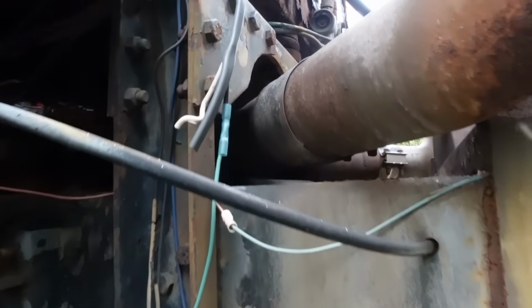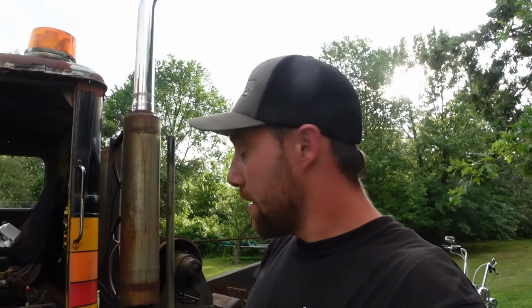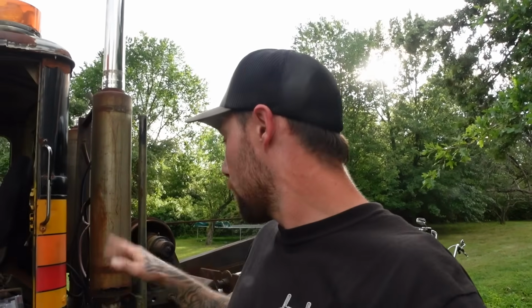It's got dual exhaust, obviously, being a V8 engine. So first order of business is to go in there and get those underneath sections. It goes from flex off of the manifolds, maybe 3 foot or whatever it is, and then it turns to that hard 4-inch pipe, and comes out to these elbows. So I'm going to whack it before the elbows, put a new straight section in there, and then fire the truck up. Hope that it doesn't leak at the mufflers. Then I could leave those just for this weekend. But if they leak real bad, whatever, it's crazy, I'll whack them off. I got fresh mufflers over there, and we'll deal with that.